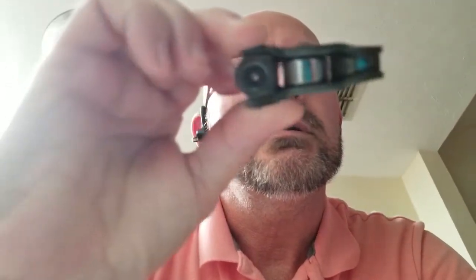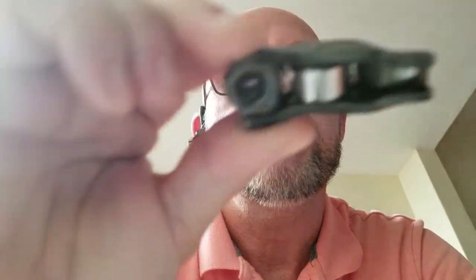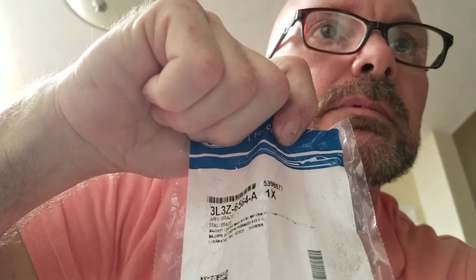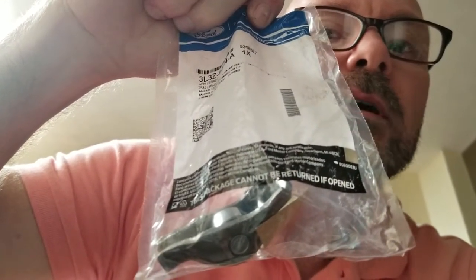So I decided I need to get some new parts obviously, and decided to get a whole new head. When I went down to Ford initially, I wanted to pick up some cam followers — we all know what cam followers look like. They've got a little hole up top for the oil, that rides on top of the lash adjuster, and this end here goes on the stem of the valve. I went ahead and got a couple of them, about twelve bucks a piece. You can see the part number there.